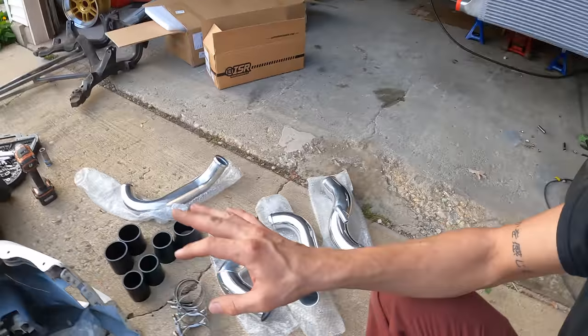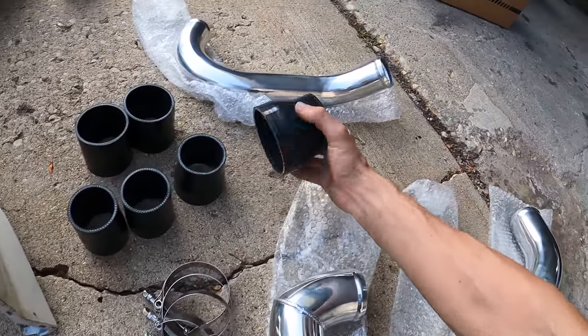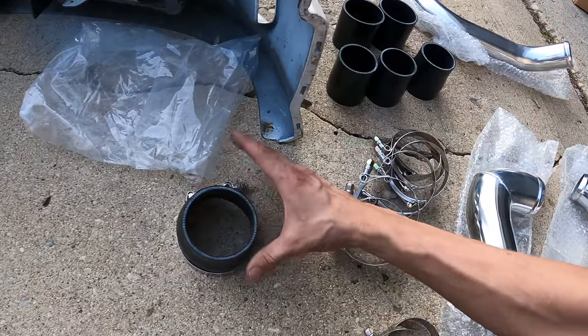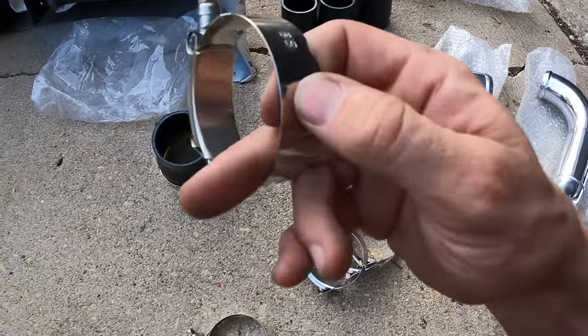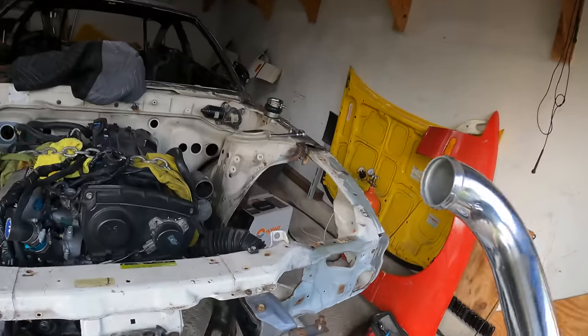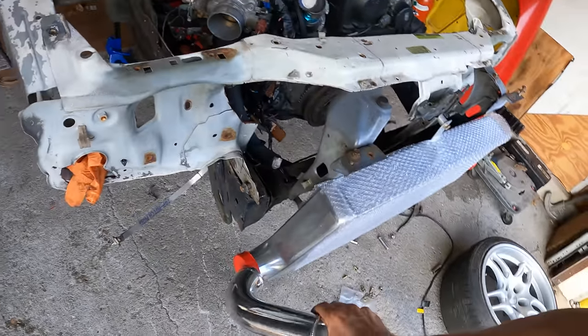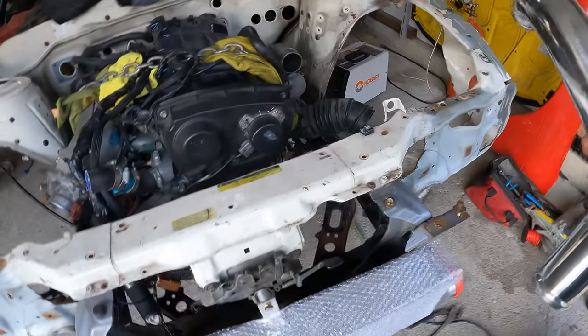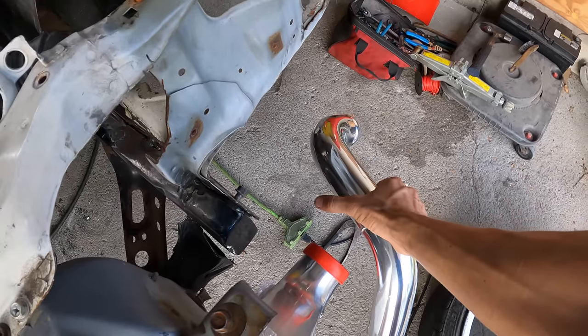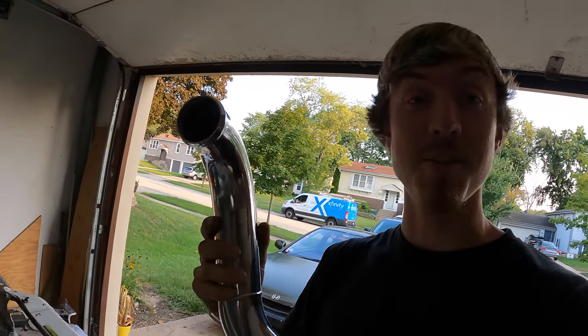To make this easier, I've organized all the parts by size. Generally speaking with intercooler pipes, the smaller diameter is going to be on the hot side. The hot side is the side that goes from the turbo to the intercooler, as opposed to the cold side, which would be from the intercooler to the throttle body. It's referred to as hot side and cold side because after you drive a turbo car, you can literally feel the pipe on the hot side — it'll be hot — and then you go to the other side and it'll be cold because the intercooler cools. So all of the terminology actually makes sense.